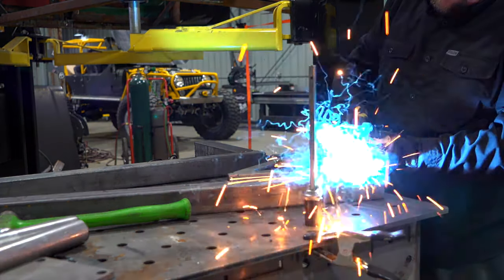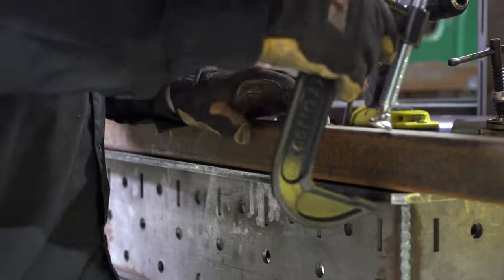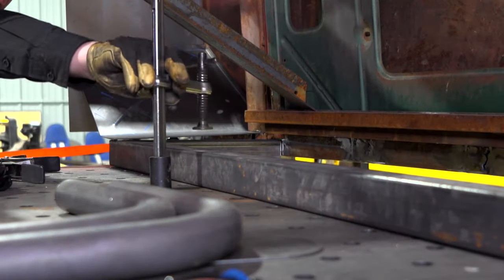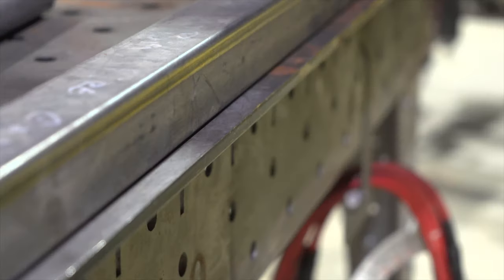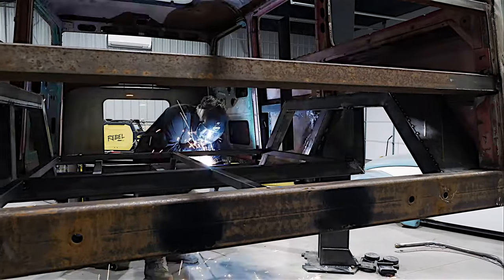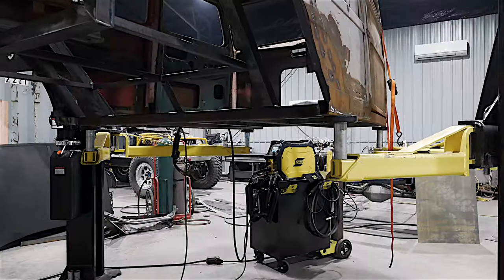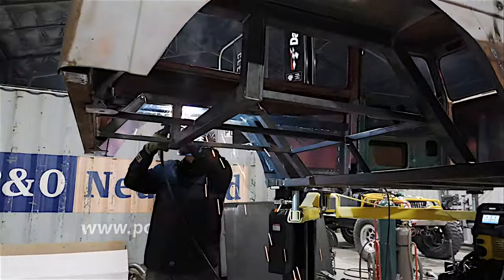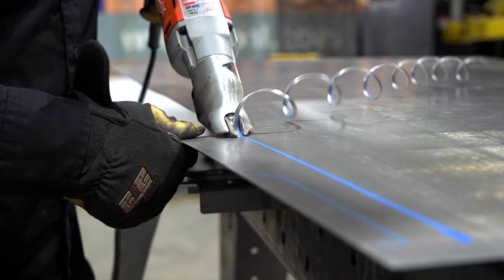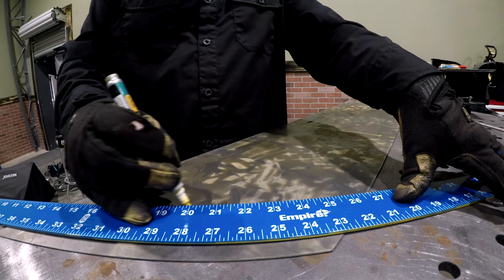I've got to get some strength back into this body, so I'm going to build a floor substructure out of some 2x2 16-gauge square steel. To make sure it's good and square, I'm going to put the entire body onto my Artec Industries fab table and then add in all the main pieces. Then it can be skinned with some 18-gauge sheets of steel — with bead rolls, of course, now that I've got a bead roller.